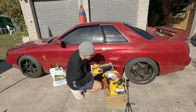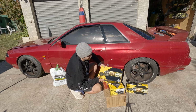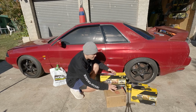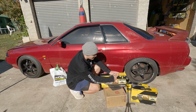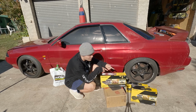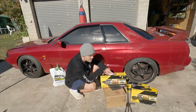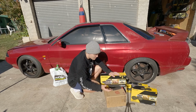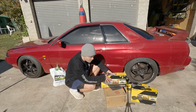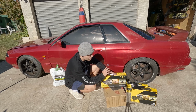So we've got some 6 inches for the front, 6x9s for the rear, 5-channel amp to do speakers and sub. So I can just run the one power cable to it, the one earth, the one signal wire, and this will do 300 watt at 2 ohms. So then the next thing to do was to buy a 2 ohm speaker, because if you run a 4 ohm sub, it will only do 150 watt.